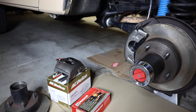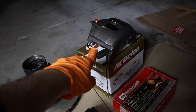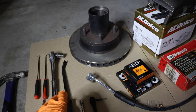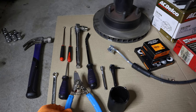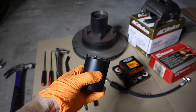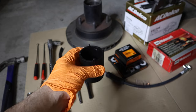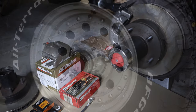The Dana 60 will be very similar, and so will the Dana 35 and Dana 27. Here is the disc brake rotor with the hub assembly already assembled, a new disc brake caliper, brake pads, brake line, bearings, and bearing seal. The tools required are pretty simple — just your standard ratchet, pry bar, screwdrivers — but you will need a snap ring plier and the four-prong spindle socket. The Dana 44 uses the four-prong on the manual hubs; automatic hubs will be slightly different. Your local parts stores will have all of these in stock.